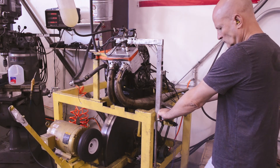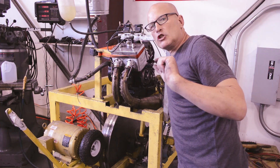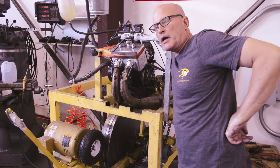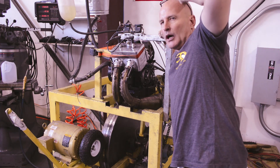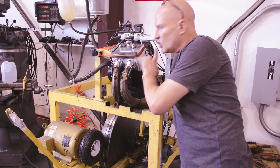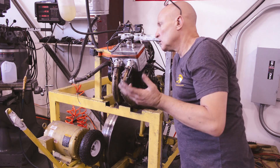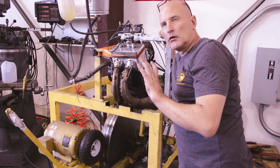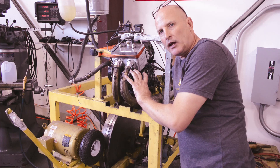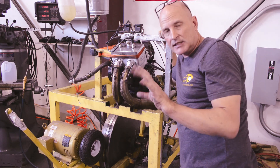I went from 50s to 40s on the pilot. I think that the last engine had such big ports and made such great power — not usable power, but great power — that it used more fuel. Same alcohol carburetors, so I'm having to readjust to the new engine, which should be lower volume, higher velocity. The needle adjustment seemed to make a little improvement. I think I'm way too fat on the bottom, and I seem to be okay on the mains, although I'm not positive yet because it's not running crisp enough up there to find out.